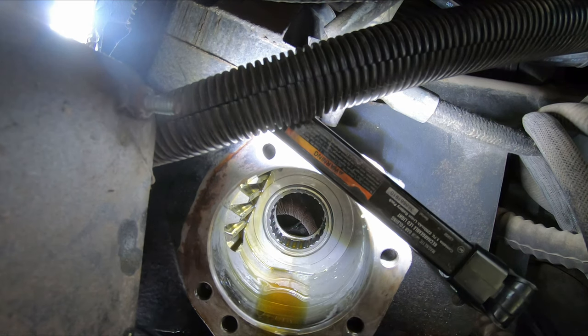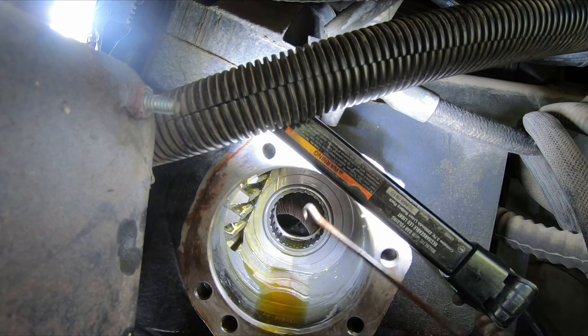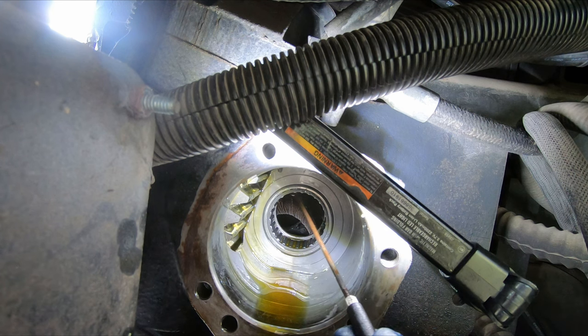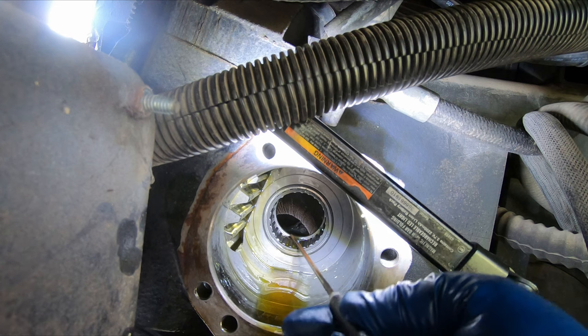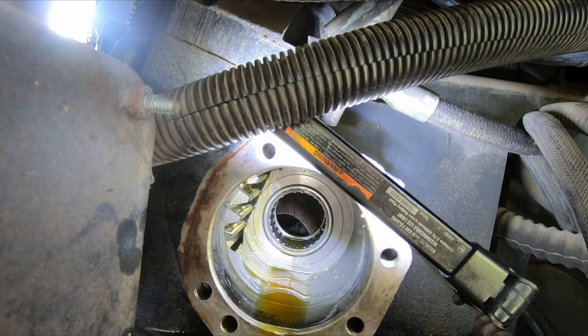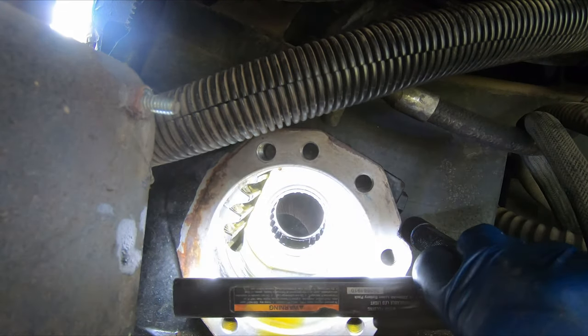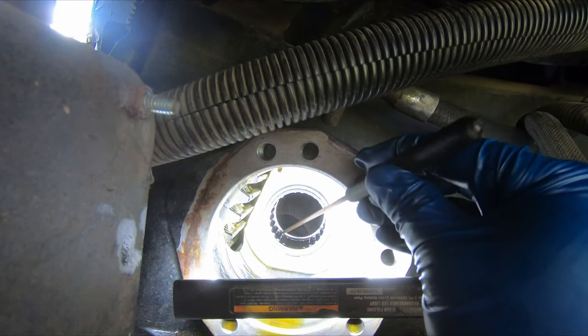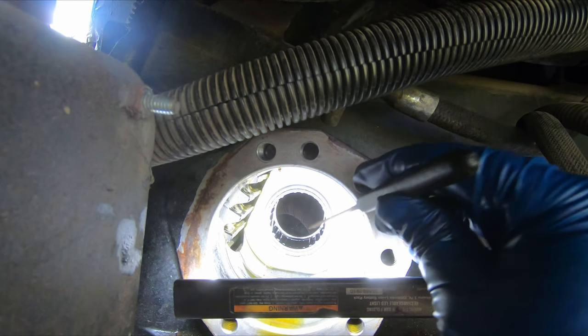So the inside seal, the pitman arm, is actually pretty easily accessible from this side. You want to do both sides, because what you want to have is like a hooked pick like this. You want to just take that in and run it around the inside of the groove. You want to feel metal the whole time. And you can see down there, there's a chunk. So you take that chunk, you just throw that out the back. Maybe use a straight pick for that. You want to make sure to clean your tools often so there's no grit or sand or dirt getting in there. You would hope that it would get flushed up pretty quickly, but this oil filling everything up doesn't make everything super easy. There's a little seal chunk in there. Hello. I saw you.